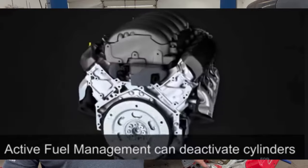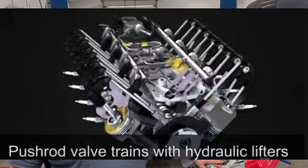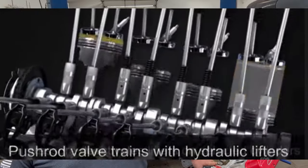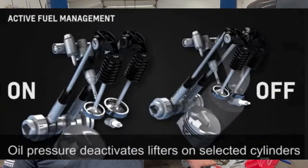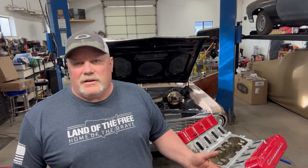The reason behind it was GM wanted you to get better fuel economy and less emissions. The way they did that is if you had a V8, they cut four of the cylinders out. It was only under light to no load — just cruising down a flat highway, no hills. But as soon as you put your foot back in it, it would go back to eight cylinders. And you could see that on the dash — sometimes there was a dash indicator that showed a four-cylinder mode.